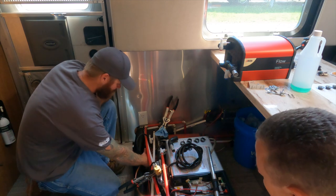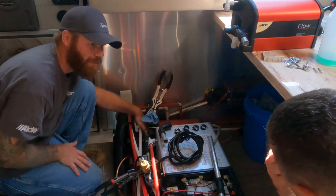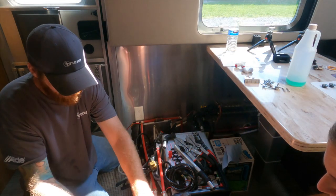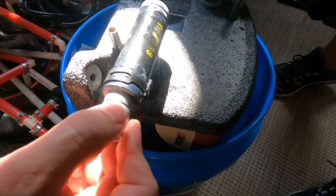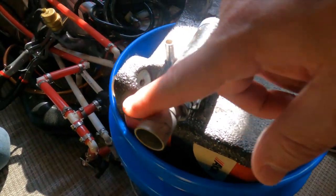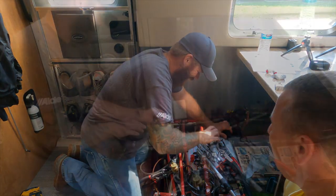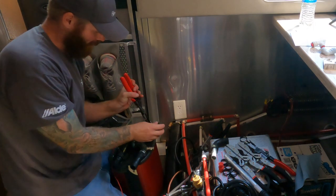This is the circuit board that controls your second pump, because with the flow we have dual pumps — two dials, exactly the same pump. We'll get it nicely cleaned up underneath. When we take things apart that are rubber on aluminum, we're checking for the breakdown of the aluminum — you can start to see a collection of deposits as the glycol breaks down and the atmosphere interacts with the material. Your tubes and hoses are looking great — not cracked or bulging.